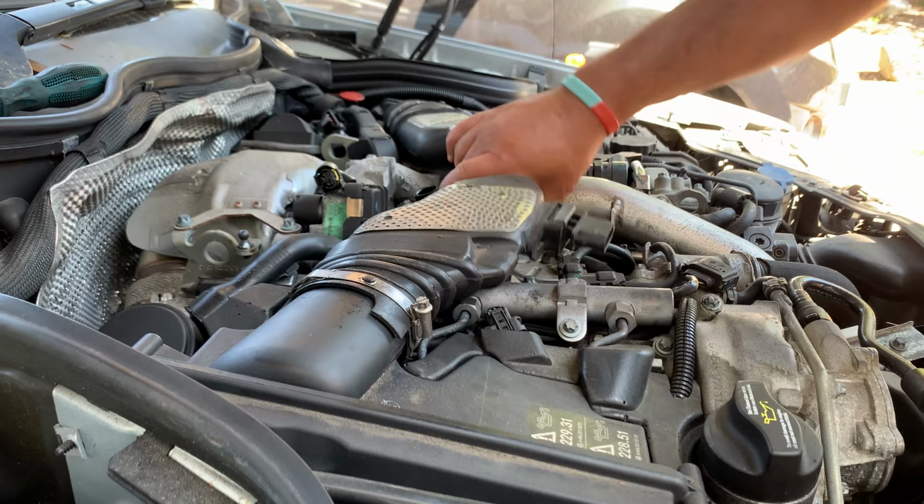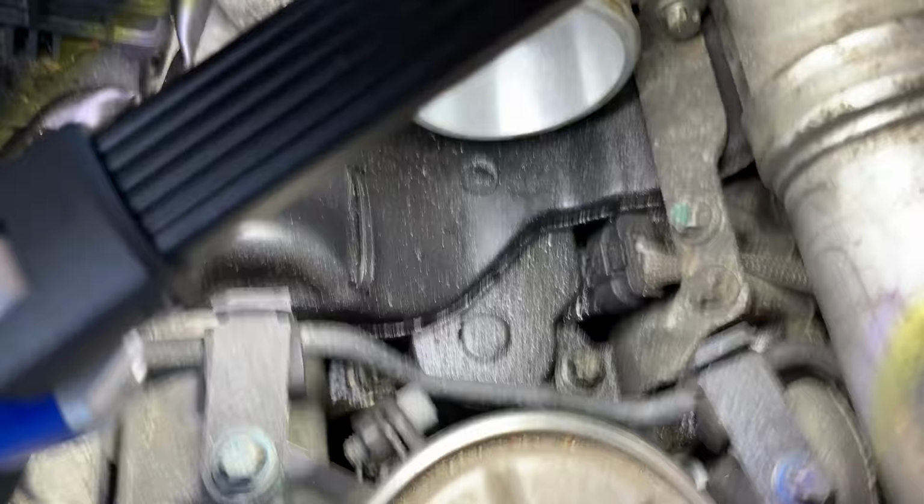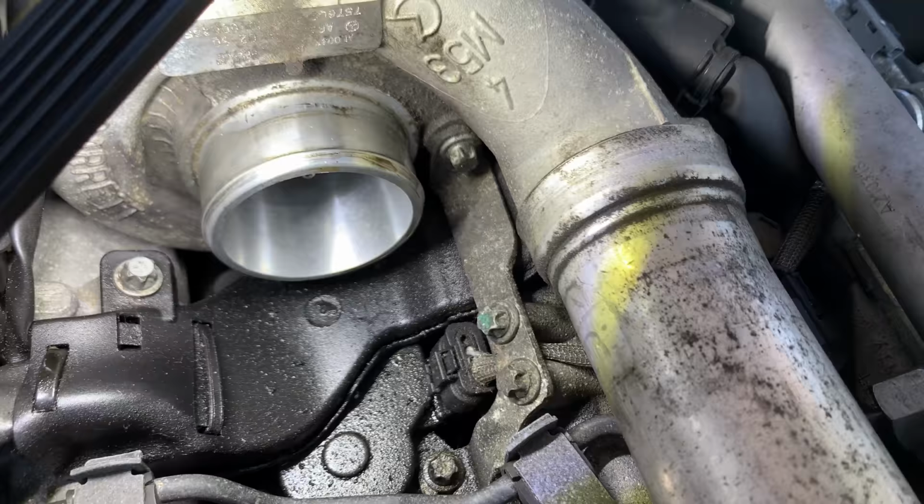Flap is just underneath here. Bunch of oil. It's just a connector there that we can see. Right, then we've got the gray wire there for the signal. So probably gonna do some testing now with the ignition on.